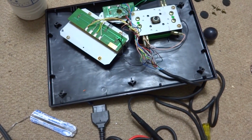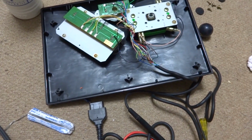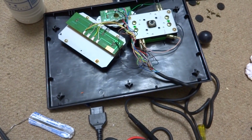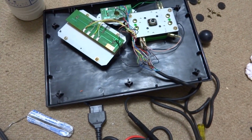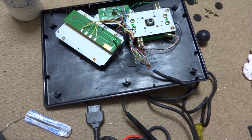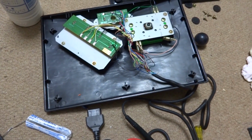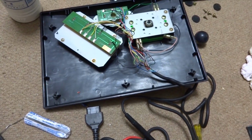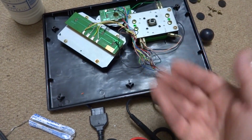You want to make sure that you go through and double check, make sure that you're 100% sure which wires go with which wires, especially when you're dealing with electricity and you have high voltages. You don't want to just start guessing and putting two wires together because they're the same color. So just make sure that you're safe with that. And I went back and double checked, and I was completely wrong, like I had thought. There was 13 wires on this, 12 wires on this.